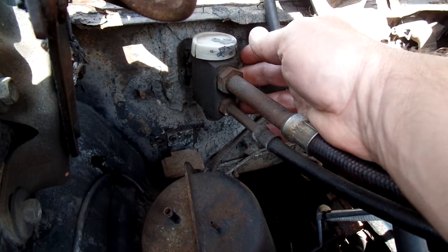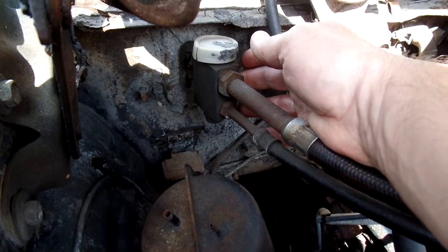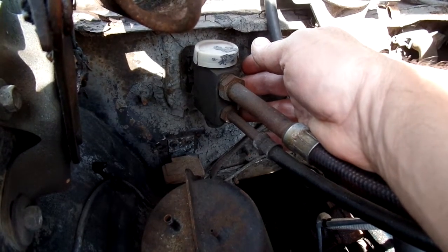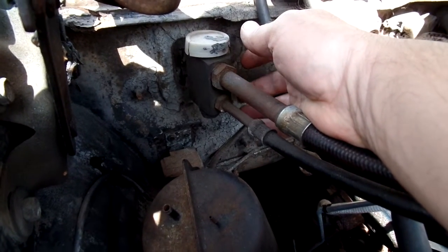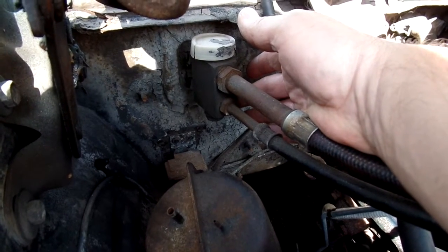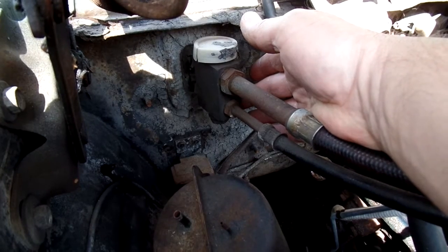It's like a radiator, the evaporator. As it evaporates, it cools that metal in the evaporator, the copper, and then the air blows through it, and that's how it cools the air. So the hotter it is inside, the bigger this orifice should be. And I'm talking a very small orifice. I think it's about the size of a human hair.